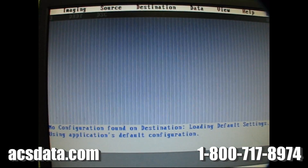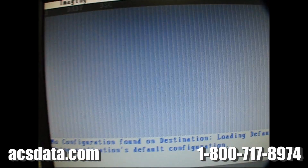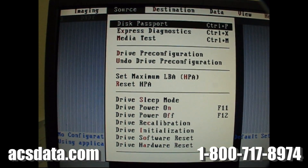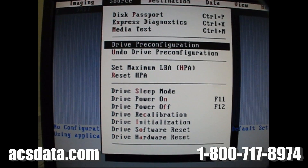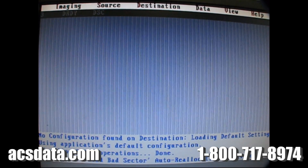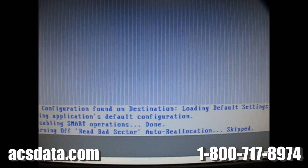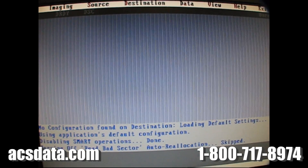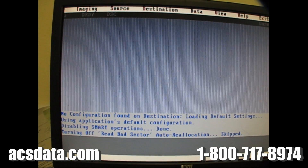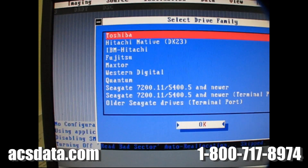This is where we have to be really cautious about how we proceed. I'm going to take this up here as our source menu for the drive and basically do what they call a pre-configuration of the drive here in our imager. Essentially that disables any of the SMART operations — it turns off the drive's inherent programming to read bad sectors and things like that. So we're going to bypass a lot of the firmware operations within the drive. The next thing I'm going to do is actually build a head map of the drive.